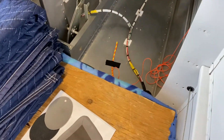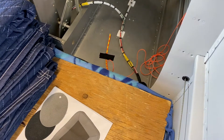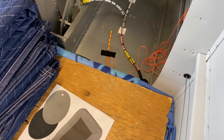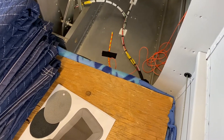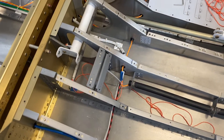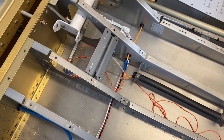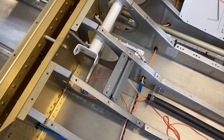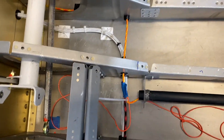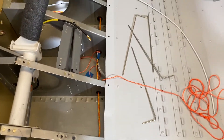The orange and yellow cord is the main trunk coming back from the panel. If we're over 55 feet we can trim that one back to just where the back of the tape is, to give us another six inches or so if we had to. It comes out here and splits — the red cord is for the fuel center line, that's all that comes in on this side. The orange cord, the real thin string, is for the grip switches.